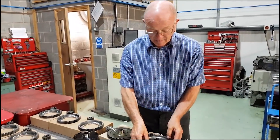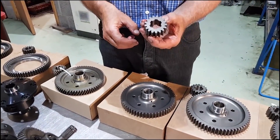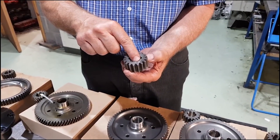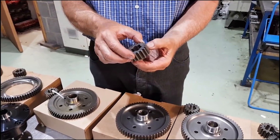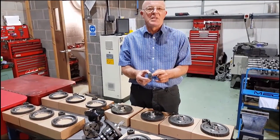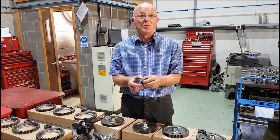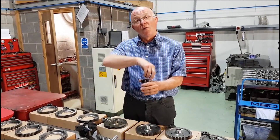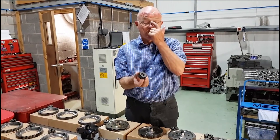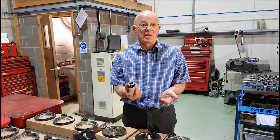Is it a different material spec as well? People say that the pinions on straight cut sets break, because the root of the tooth runs very close to the root of the spline. To give these belt and braces, we've upgraded the steel to a VAR material — vacuum arc remelted — which is a good quality steel that's remelted to take more impurities out. We've been making these for eight to ten years now and I've never seen one break.